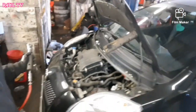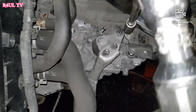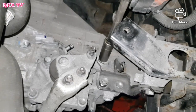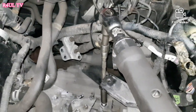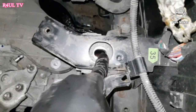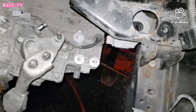We've sent the car down and I'm going to take the mounting bolts off on the top. There's one there, another one right here. The mounting bracket is off. I forgot to mention there's another bolt right in the middle here — take that one up as well. The bracket won't come off without it. That one is a 17 milli; all the rest are 14 milli bolts.